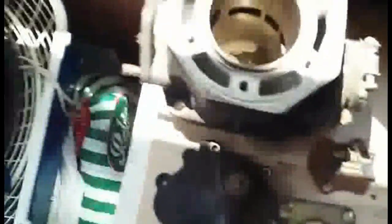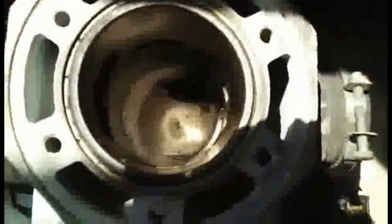The crank, as you can see, sat for a little bit — it's going to need a good cleaning and everything. I've got all new seals and everything. The cylinder was burned out, but we checked both cylinders and this one's in real good shape. Doesn't need to be honed or anything.